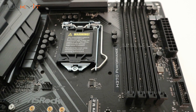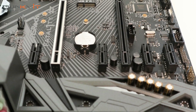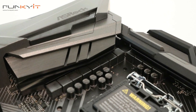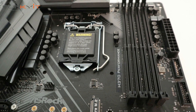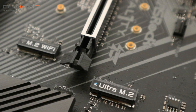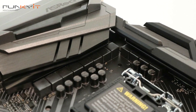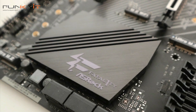To compensate, you do get built-in RAID support, optional integrated AC Wi-Fi, and support for up to 14 USB ports. One of the things that makes the ASRock H370 Performance stand out is the amount of features: Digi Power with a 10-phase power design, support for DDR4 2666 or above, Intel Optane Memory, and AMD CrossFire. It also comes with Intel Gigabit LAN, dual M.2 slots, PCIe steel slot shielding, USB 3.1 Gen 2 both A-type and C-type, ASRock Polychrome RGB, and Creative Sound Blaster Cinema 5 audio.